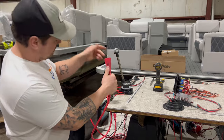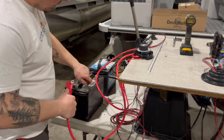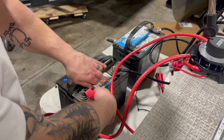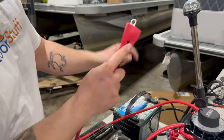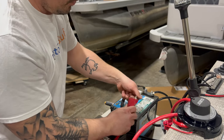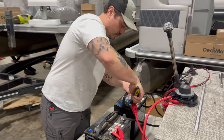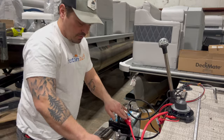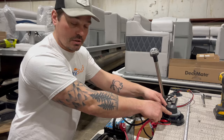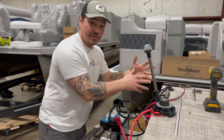I've got right here my number two — my house battery — and we're going to run that to my house battery on the positive post. And number one goes to the starting battery. I can cover these positive posts right up, and what we've done now is run power to our switch and run our grounds from the battery to the bus bar, which is linking the two grounds.